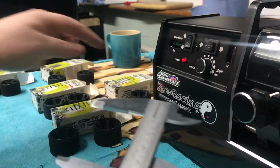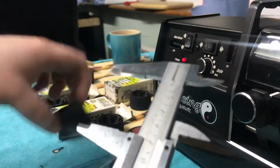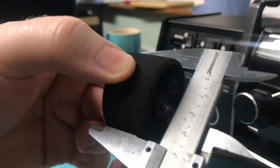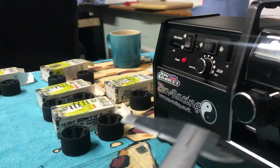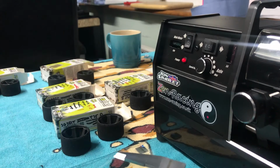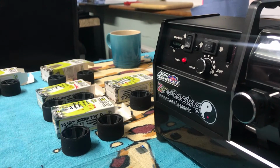And I will go through all of the rear tyres one at a time, going, okay, that one's bigger, that one's much bigger, that one's about the same, that one's about the same, or in fact, but as I know, the one on the truer is slightly smaller, it's about 41.2. So then I'll keep a note of that 41.2 in my head of the smallest rear tyre,